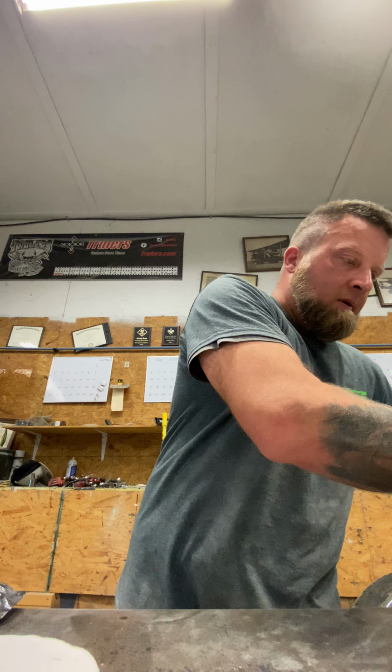I don't care if it's 100 degrees outside or if it's 70 degrees outside. Weigh your filler on a scale. It's 2% hardener per body weight of the filler. Ain't getting into that.